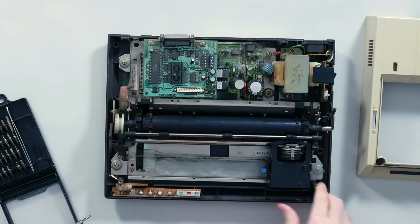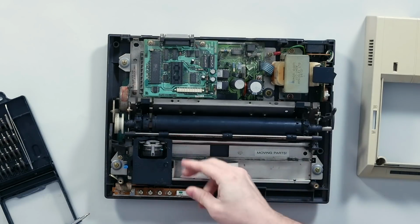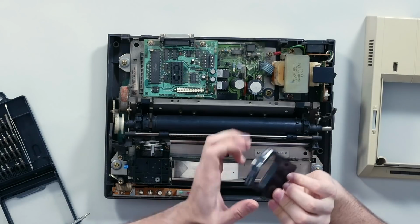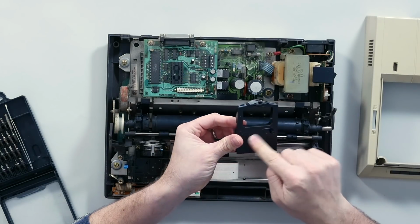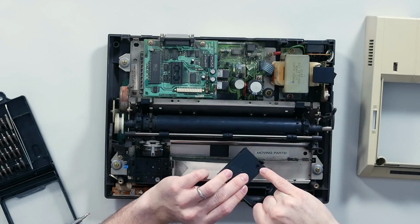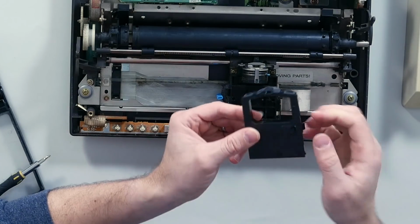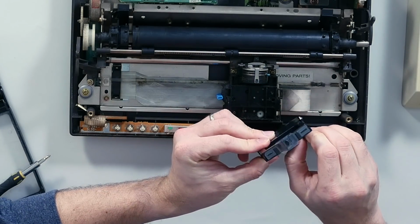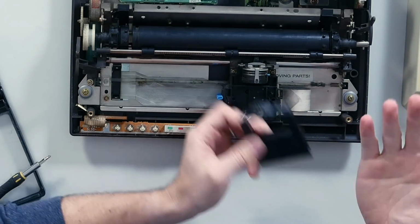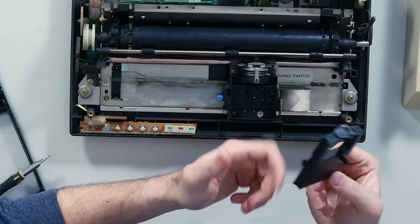So inside we have the ink cartridge, which is a ribbon style, which I can't remember how it comes out, something along those lines, there you go. There's a little continuous ribbon which runs around on the inside of here. It's all spiraled up, runs around. There's a little cog that engages on the bottom here. So as I push this head forward, you can see it spins. Now that turns this little wheel, which you can also forward by hand, which has the ink pressed in it. I don't want to touch it because I'll just wipe ink everywhere, but the pins fire through that and imprint that ink onto the paper.